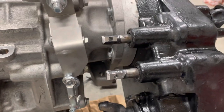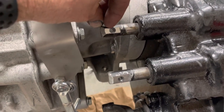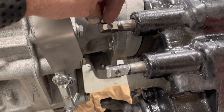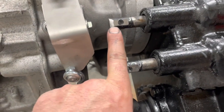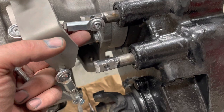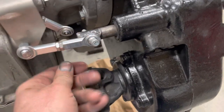Now you can see the final stage of this assembly. As a review: we've got our inch away from the furthest tucked-in position, split that distance — so half inch from the end — and drill a quarter inch hole. You'll need to use a carbide ball end mill to drill through this hardened steel. I like to put a flat there — it helps when you're hitting it with a center punch to get ready to drill. I also like to chamfer off the edge just a little bit, because when you go to put these swivel ends, these heim joints in, it provides clearance so they don't bind up.